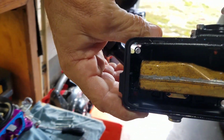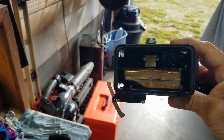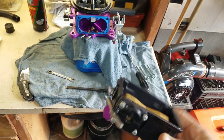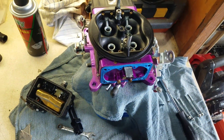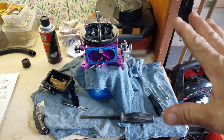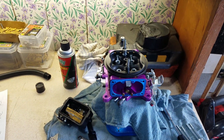You can check and set your floats on these carburetors by tilting them upside down and setting the level — when you get your gas in there it'll be at the right level, though you might need to do a little adjusting. That's just a tip that comes up when you look these carburetors up. I didn't have any problems with this side. There's a little bit of white residue from the additive I'm using, but overall it's still super clean. I'll mention — I'm no carburetor expert, this is the first time I've torn one of these apart, and I've got instructions.